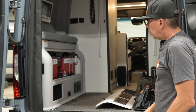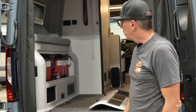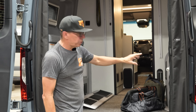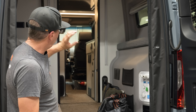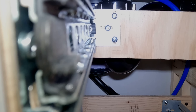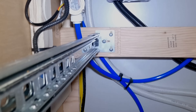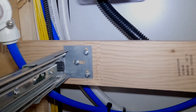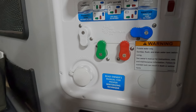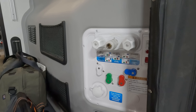There's breakers all in here and three batteries — you'll see two here and one underneath, with an option for a fourth. Batteries on this side, water on this side. Winnebago puts in roughly a 24- to 25-gallon tank; this one has been upgraded to 35 gallons. We've also done a water filtration system tied in together. This van is being set up for cold weather — there's an actual heating loop run underneath the water tank. That keeps the cabinet warm so the water doesn't freeze, including where the pump is, which is pretty much right on the floor with not a lot of insulation. Now with that heating loop in there, everything stays nice and warm while the heater's on.